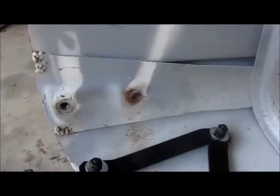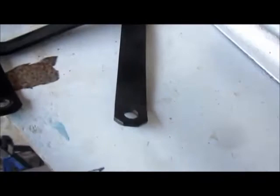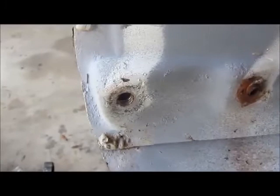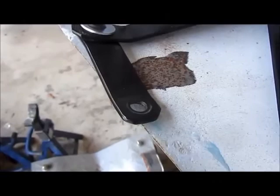Here's what I wound up with on one side of the hood. You can see it's a rusted-out, shouldered, threaded piece that this end of the hood hinge goes on — the threads were stripped, so I had to find a remedy for that. Back here, someone had drilled and tapped and put a larger bolt in it that really would not work properly to attach to this end of the hinge.